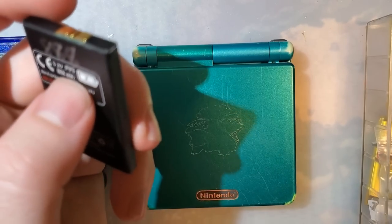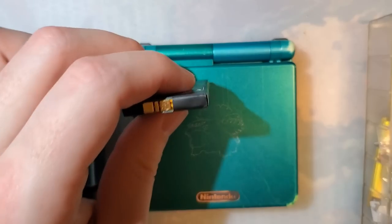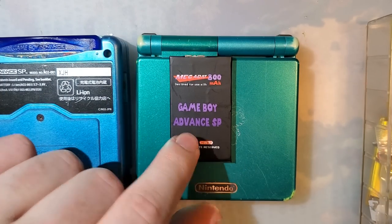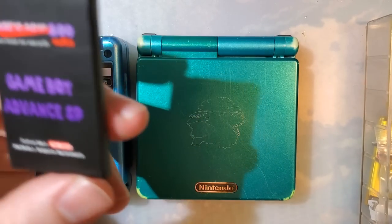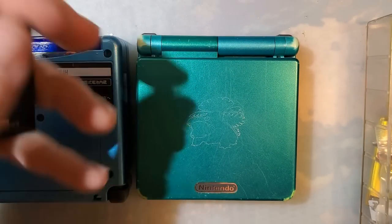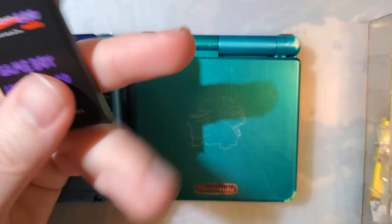When I did all of my capacity testing with all of these batteries, I did them outside of an SP, and I tested them down to 2.85 volts because that's what my battery charger does. I have a new battery charger that has a programmable low voltage cutoff, so going forward I will only be testing SP batteries to 3.4 volts. I'm just throwing that out there because I want you to keep that in your mind as you're looking at these runtimes going, well, gee, that doesn't add up with the power usage you showed in whatever video. And yes, you're right, that doesn't add up, because the SP isn't using that full capacity, and unfortunately there's really nothing we can do about it.